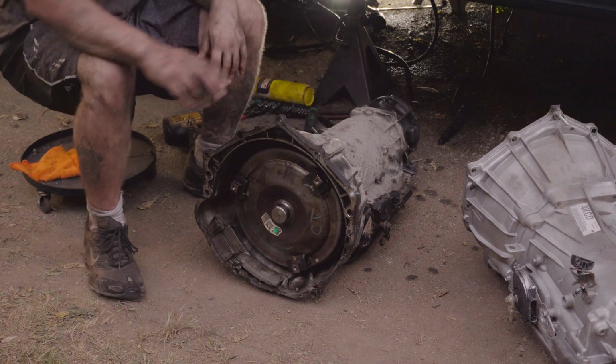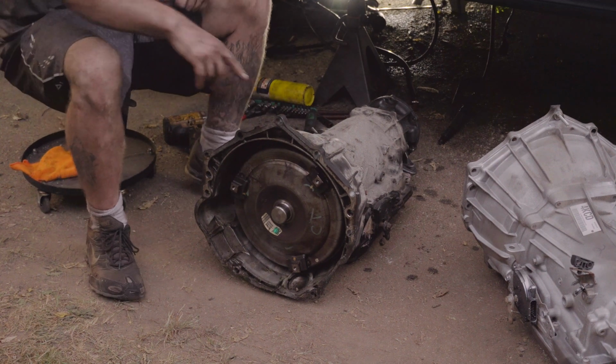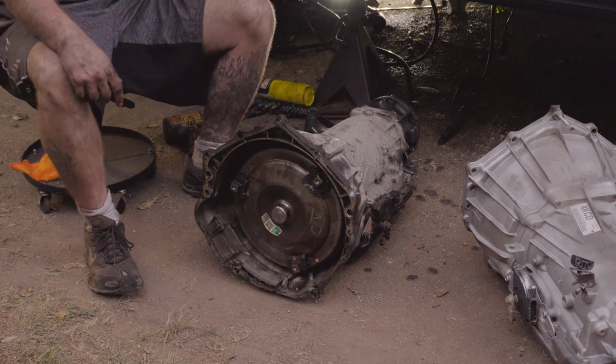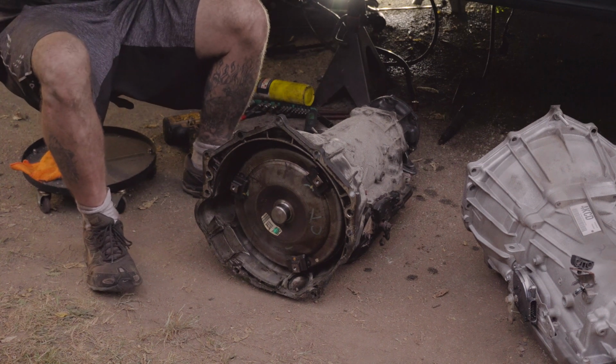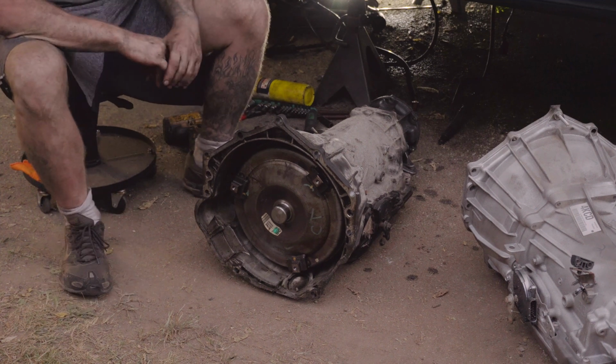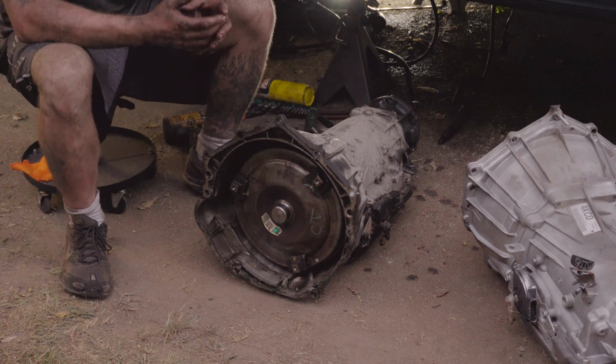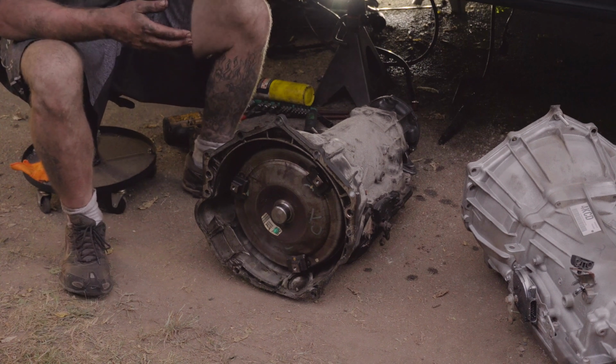So to get these, you have to do the same thing I just said with the top bolt. You're going to need to look for it, get you a swivel, put it up in there and bang it. Now, before you even do any of this, I'm going to recommend that if you're working on a 4-wheel drive, you need to remove the transfer case from the start.